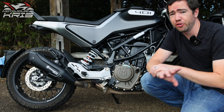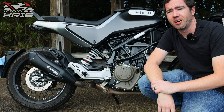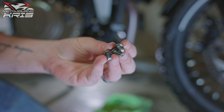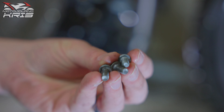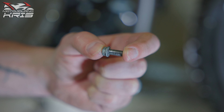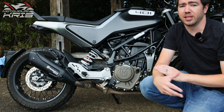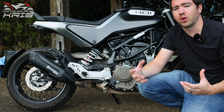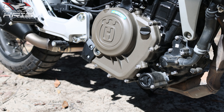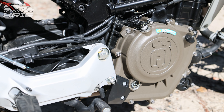While I've been doing stuff on the bike, I've actually noticed that some of the bolts are on the lower quality end of things. I've got metric and imperial tools and I've never really had a problem with my tools — they're not the most expensive but certainly not the super cheap stuff either. But a lot of the bolts I just can't seem to get a proper fitting tool onto, which to me means those bolts are a bit on the cheap side. Some of them have been quite soft bolts, which is not ideal. I would definitely think about replacing those with higher quality bolts for long-term ownership.